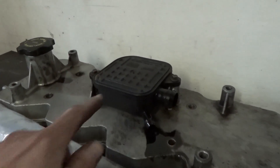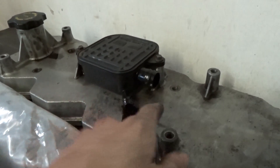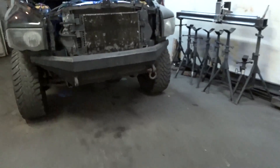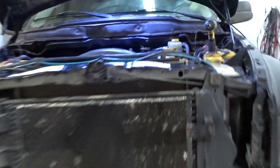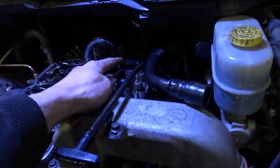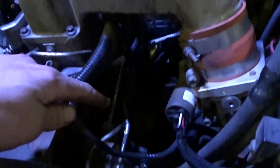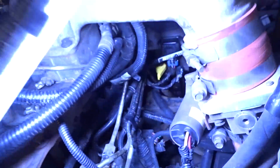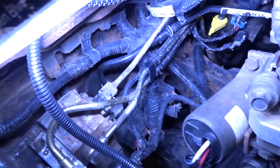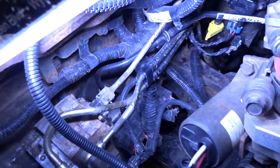You can see they have like a catch can built into these things. The blow-by comes out here and it kind of drains the oil back through here. That's why I've got to put the catch can on the driver's side — you can see the hose comes there and then down into the block again, so I'll be able to drain my catch can in there.